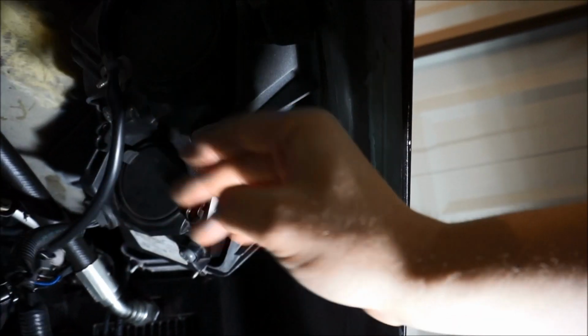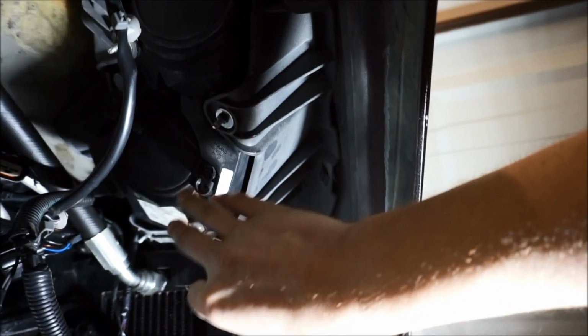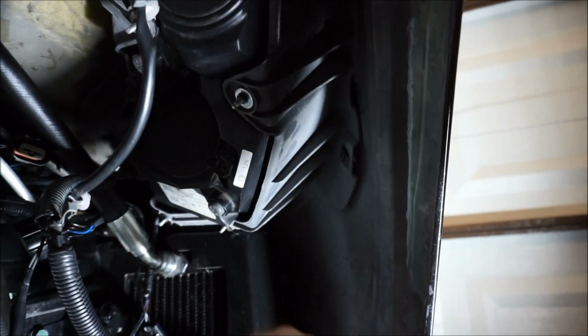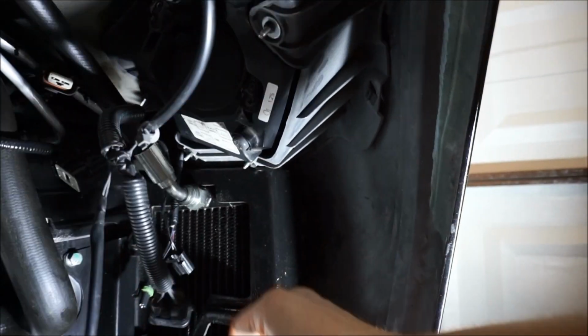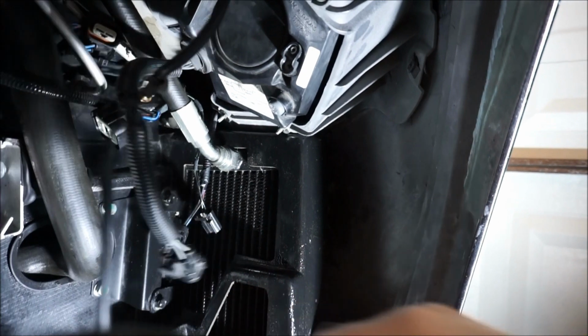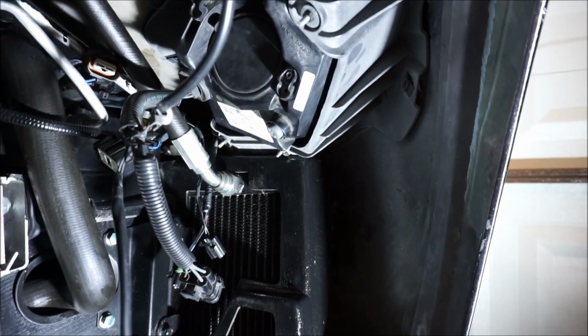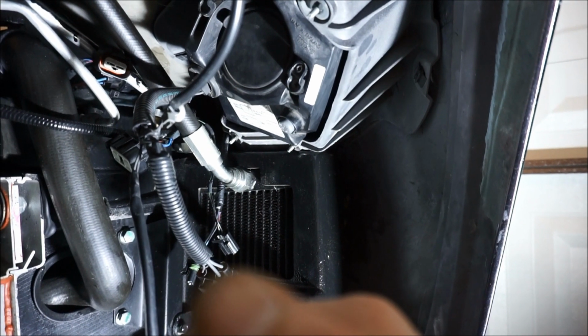You guys can see the wires coming off of the headlight here. And then I think these are all connected, the wires are all inside here. It's actually an encased housing so water doesn't get in there. And then I'm gonna plug this in right now into the wire harness, the OEM one right there. And then I'll plug this top one right here into the other wire harness down there. And we'll call it good. Now once I have that all done, I'll be able to put the splash shields back.